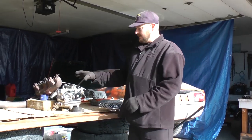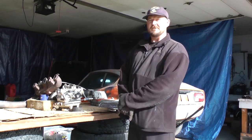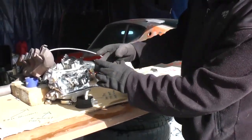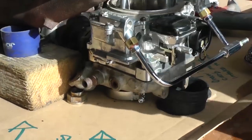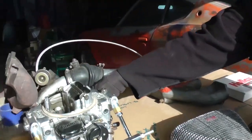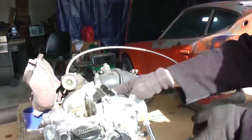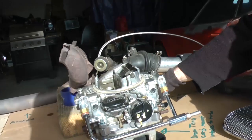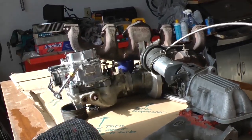For blow-through or draw-through, you use any four-barrel carburetor you want for your engine. You bolt it down to a flange, and this flange has to have a draw to allow your fuel-air mixture to be drawn into the intake of the turbocharger. Air comes in, mixes with fuel, goes into this draw-through turbo area, gets sucked into the intake of your turbo, the turbo compresses it, and shoves it into your intake manifold.